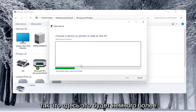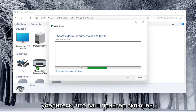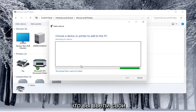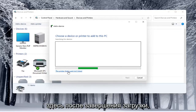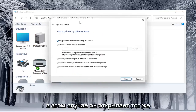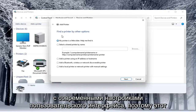This will search for your printer over Wi-Fi, so make sure your printer is turned on. If it is a wireless printer, make sure you've typed in your Wi-Fi credentials into the printer itself so it's connected to your network. If it doesn't populate in the list once it's done loading, you can select 'The printer I want isn't listed,' which opens up the same dialog screen we saw in the modern UI settings.